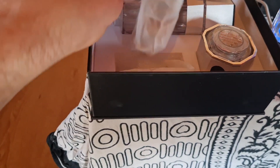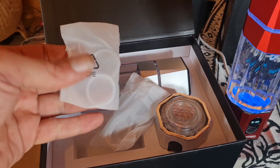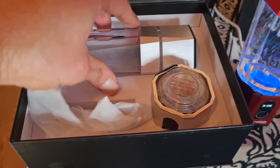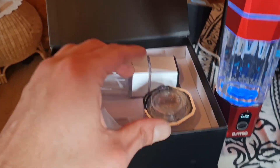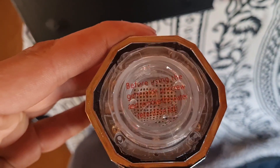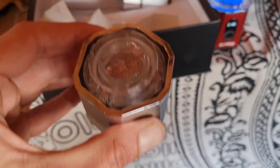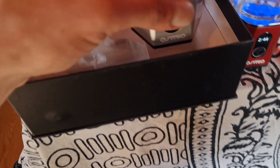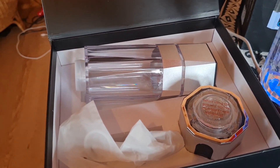The packaging is also improved. You get a USB cable, and you now get a spare set of O-rings — not needed to install immediately, just for future use if you ever need to replace them. The bottle setup is: you've got the body and lid together, then there's a new cap which stores more water to keep the generator wet. You unscrew that, screw on the body, rinse it, fill it with water, and it's good to go. To clean it, you can remove these parts and wash them with washing-up liquid.